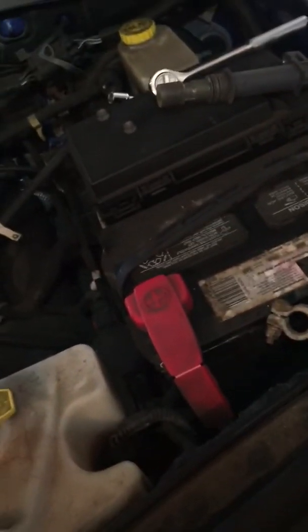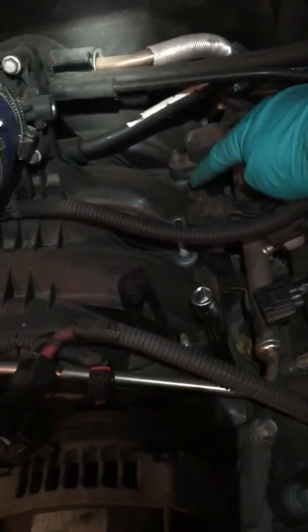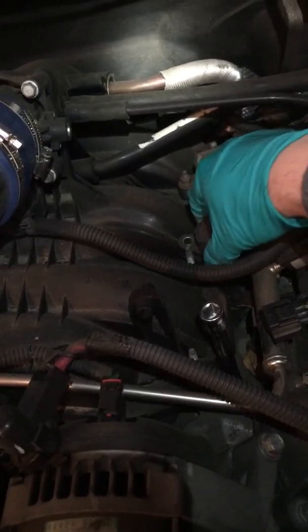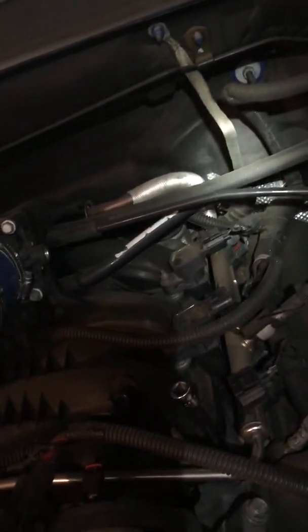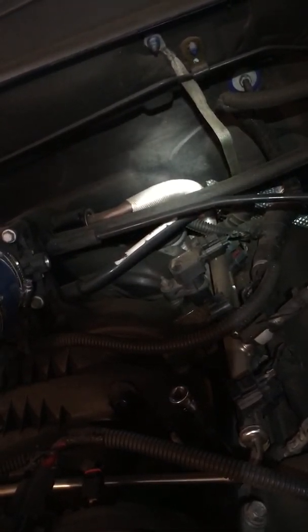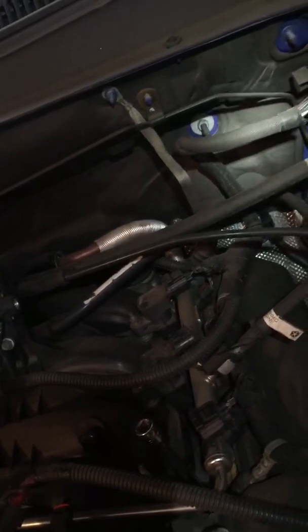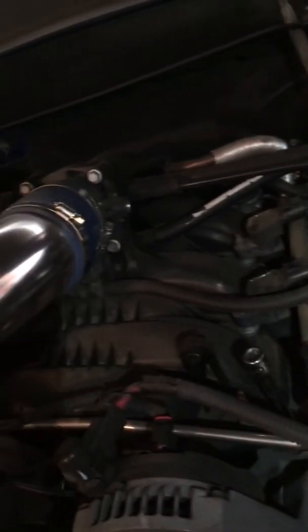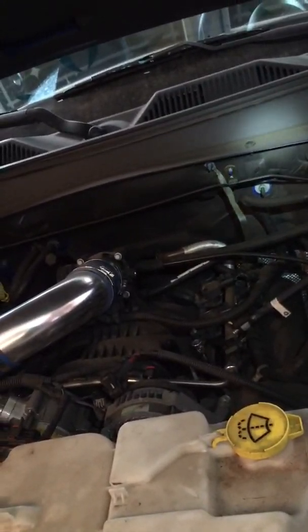So it's pretty basic. Let me just run through it really fast: disconnect the battery, look at the gap up here, see what the gap size is, gap all your spark plugs. Then take off the one bolt in back, unplug the coil, pull it out. Once everything's gapped, take out the spark plug, put anti-seize on the new one, put the new one back in. This is really just maybe at most a half-hour job. It's really simple, quick, and easy — anybody can do it, your average Joe.